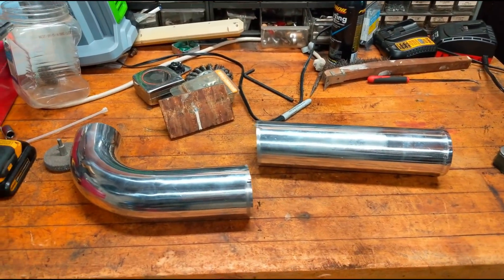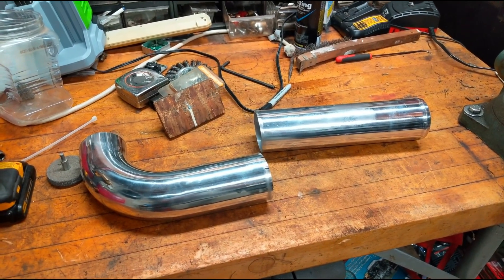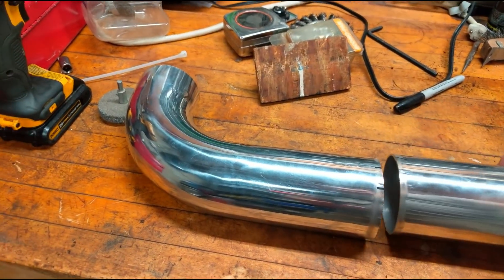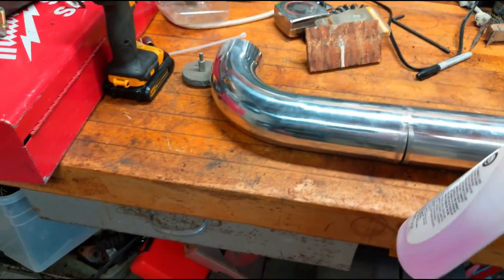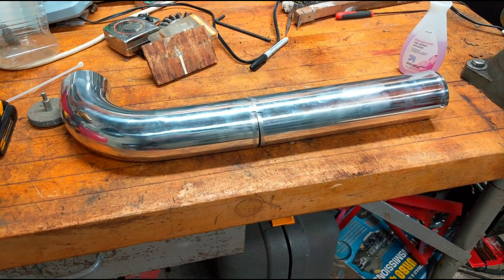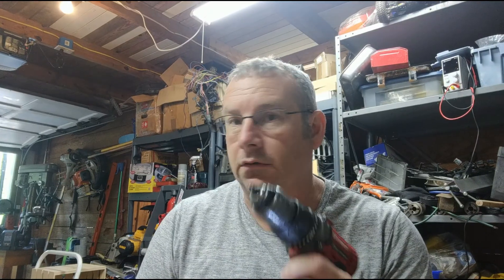Quite a few days have passed since we've been working on the car, just had some stuff to deal with. I am going to redo the hot side a little bit — where it was really close up under the throttle body, I decided I didn't like that. Ordered some more parts, so we're waiting on that. While we're waiting, we'll go ahead and finish up the cold side. The only weld I really need to do is this one connection. I've got it marked — I'll clean up everywhere except where my marks are, get some tacks. I don't actually have any acetone, so I stole the wife's fingernail polish remover because its number one ingredient is acetone. We're going to see if that cleans up the aluminum good enough before I weld. I'll get the TIG welder set up for some aluminum welding. Got the tungsten sharpened, now we'll get it in the torch and get these tacks on here.